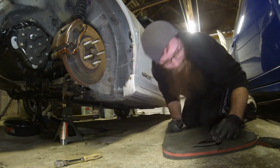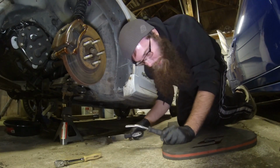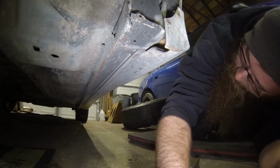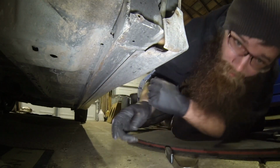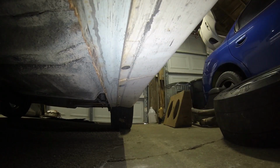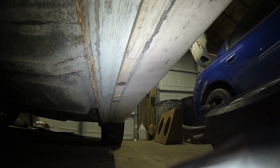Anyway, so now, hopefully, you either have a trim tool like this or one like this that you used on the fender liner or whatever tool you had. Now you're gonna go to the side skirt here. Now this one's already pulled through, so I can't really demonstrate that. I guess that one was never in. Down here, it's the same kind of setup it was on that fender liner, but under the car.